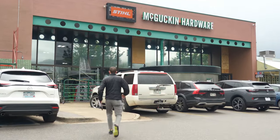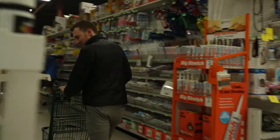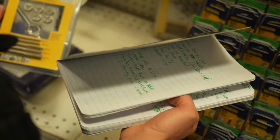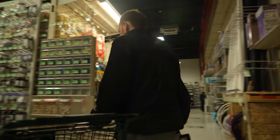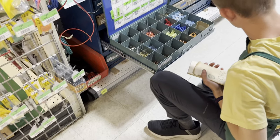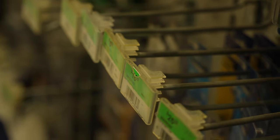I thought about doing it in SAE American-style quarter-20 thread count screws, but I thought about worldwide access to parts. You really can't get American thread sizes everywhere — it's metric everywhere you go, and in America you can still find metric with some searching. So I decided the entire build-out would be metric fasteners, all the way, matching the car which is also metric.